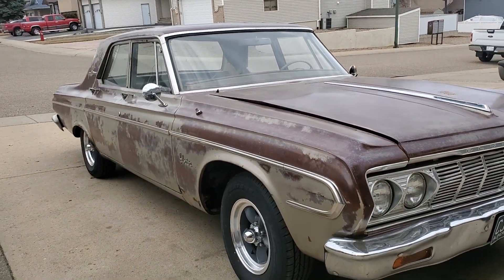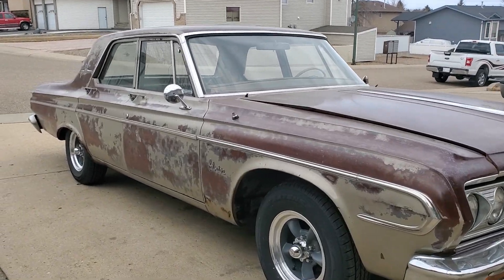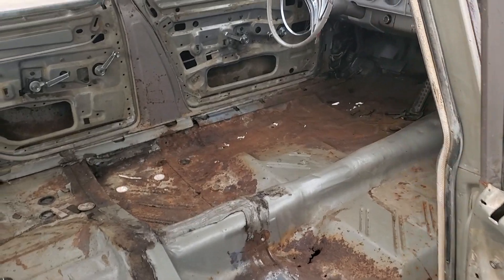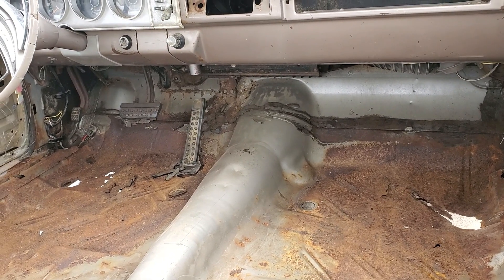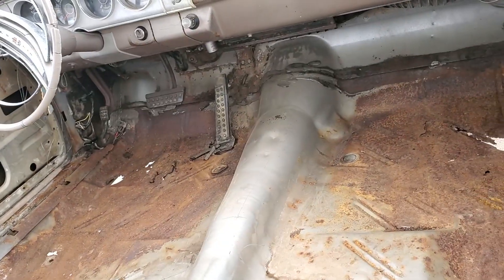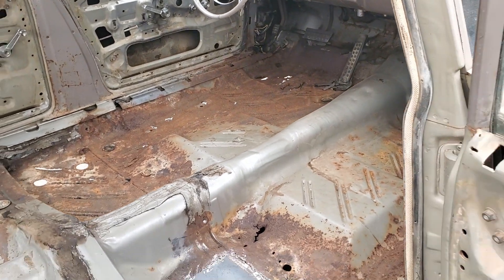I did the old Belvedere here in the driveway the other day — fired up, started right away, so I'm gonna start working on it right away. The last time I made a video I left off having started working on the metalwork on the inside, removed the carpet and seats, and bought a four-by-eight sheet of steel. I'm gonna start welding in the new metal and floorboards. I did start on one piece last year, got that one little piece in, still got to finish it up and do the same on the other side, so there's a bit of welding and cutting to do, but I'll get her done.